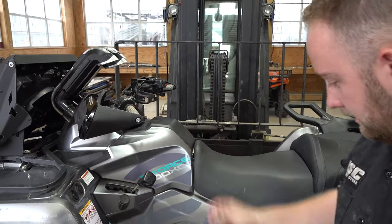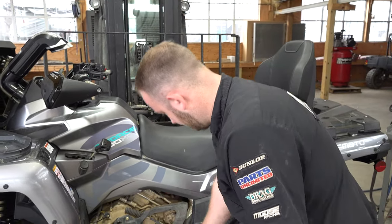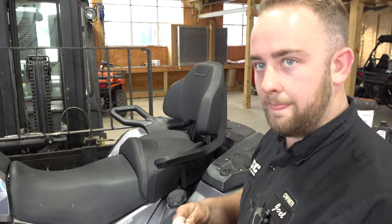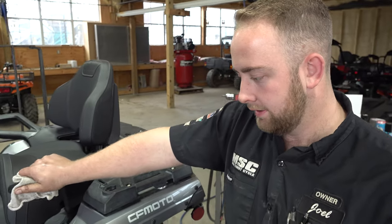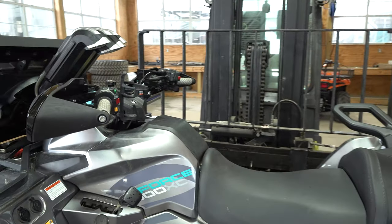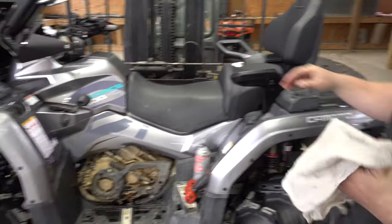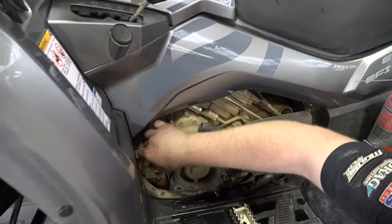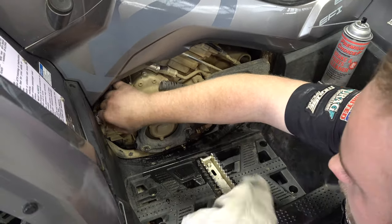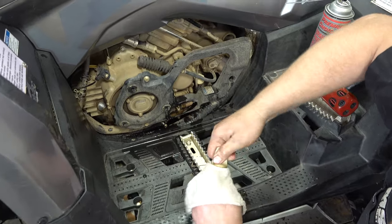About 30 seconds — that's all it really needs. And for those that have the 800, that beeping noise was the oil pressure sensor. When you first crank it after you change it, it'll have low oil pressure until it fills up — that's where it's having to pump the oil to where it needs it. So don't be alarmed if that oil pressure light beeps when you first change it. Just as long as it stops.